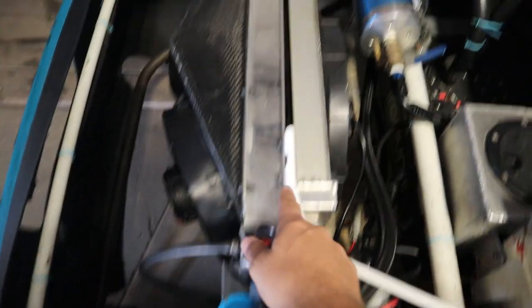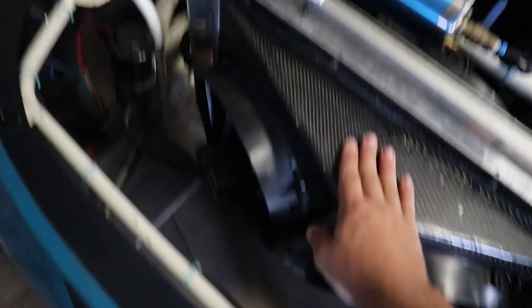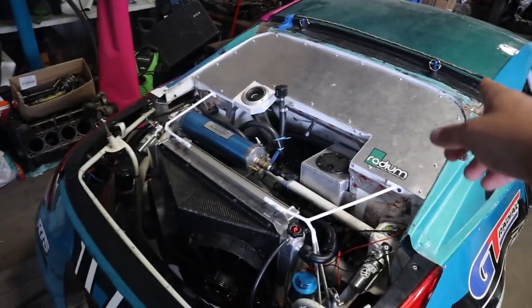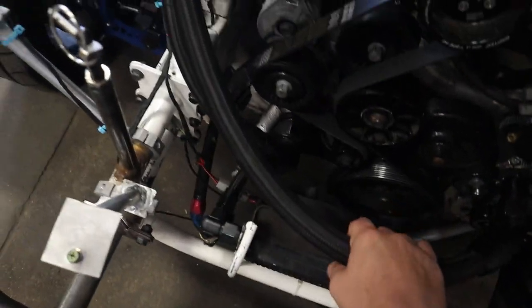So this is our new CSF radiator. We have the radiator, our heat exchanger for the supercharger. We ended up spending a lot of time making a carbon fiber shroud with new fans. Now we have to bleed it. So what we've got to do first is go to the front of the car and drain all the coolant. You could drain it from back there, but I'm actually just going to unhook the lines from the water pump and let it drain.